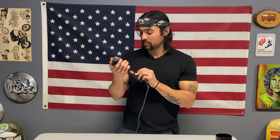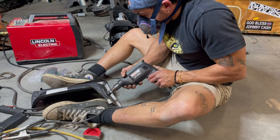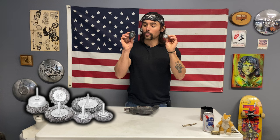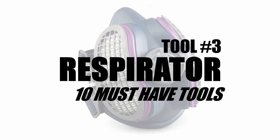Tool number two is the power drill. I inherited mine from my dad — it's probably 30 years old and working just fine. This is the corded variant; you could use a battery-operated one, but you won't get the same RPM for polishing and buffing. Like the angle grinder, you can use various attachments: poly carbide disc, flappy disc, polishing wheels, wire wheels, and one of my favorites — the spot weld remover tool. It's extremely versatile; definitely get one early in your restoration.